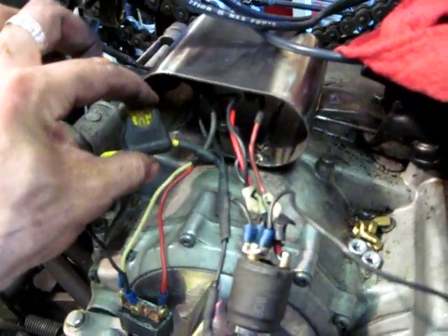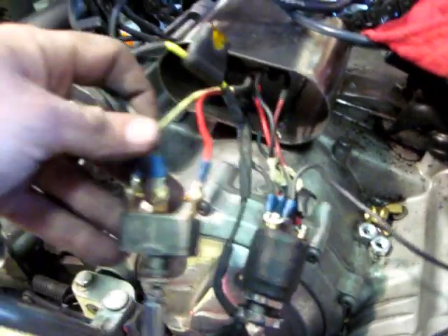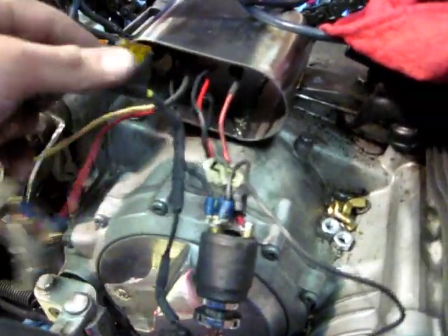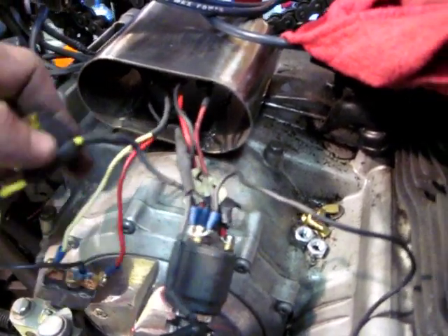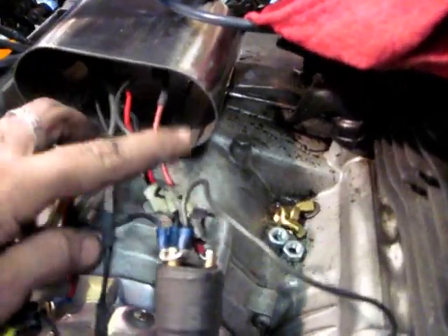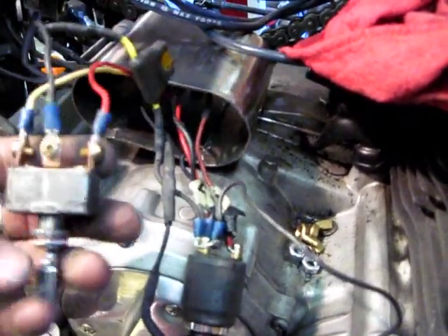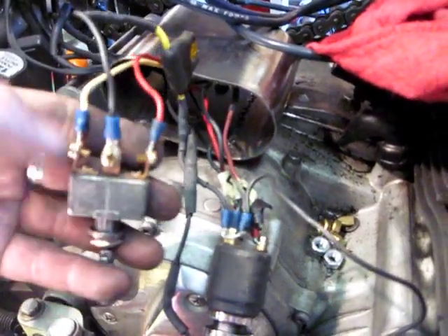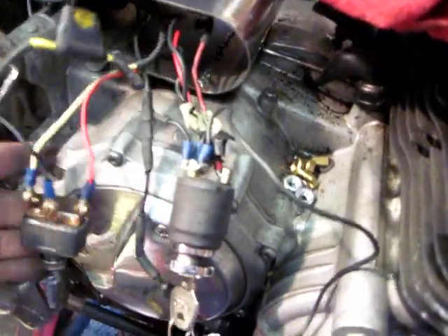The other fuse on the inside goes from ignition to the power point on the three-way light switch. So when I unhook the light switch, I can take my electric box off — all the other wires will be smooth and slide right out through the grommet. This is highs, off, and low — a three-position switch. I'll wrap electrical tape around these inside since they're shoved in a tight area, to keep them from grounding out.